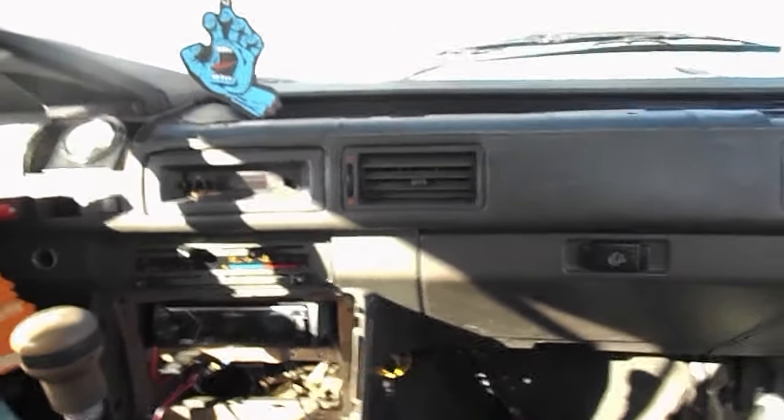What I've actually put into the car towards maintenance, like I was saying yesterday, is mostly just maintenance stuff. Spark plugs, spark plug wires, distributor cap, rotor. I had to buy 3 different caps because my 1 year of CA20, apparently 3 different manufacturers make distributors for that, and they all have different caps for rotors. So it took me forever to find the right cap, but I finally got it. Newish exhaust manifold that I got off of a Pintara R31 motor, new exhaust gasket, new TPS sensor, all fluid changes. I probably flushed the block like 6 times unintentionally. I only meant to do it twice, and then I ended up doing it 6 times because I filled up the whole system, thought it was good, had to take it all out again. Bunch of stuff like that.